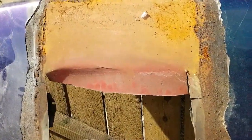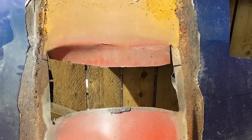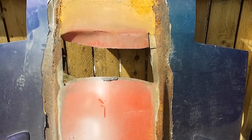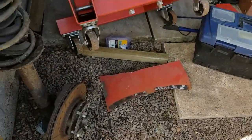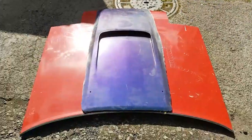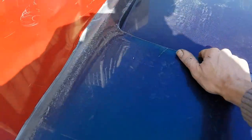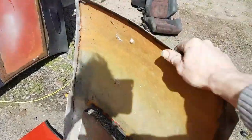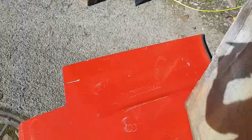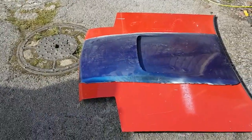As you can see, whoever fitted it for the previous owner ground it back to metal where they masticed it. They should have just kept it up with like an 80 or 40 grit and then tiger-sealed it and filled it, but for some reason they didn't. I had to cut that flap out because it was siliconed to the bonnet. Taking it off, it actually fits really nicely to the Mk2 bonnet bulge - locates on the original bulge. It needs a flap cut into the bonnet before it goes on, but it does go on nicely.